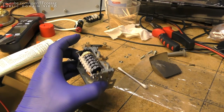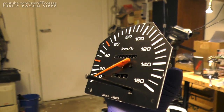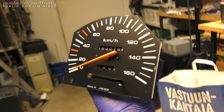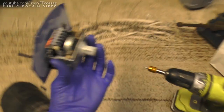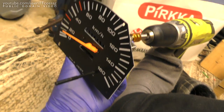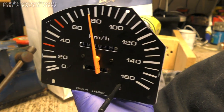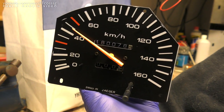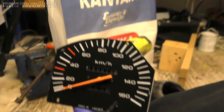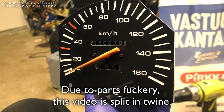All I've got to do is put all the little ancillary things — the reed switch and so on — in place, and it should in theory be good to go. I just need to figure out how to trim in the actual needle placement. I gave it a drill test — shoved the drill in the back — and it does exactly what it's supposed to do. I think it might be a bit too insensitive, so I'm going to adjust the needle slightly upwards and then give it a proper speed test against the GPS.